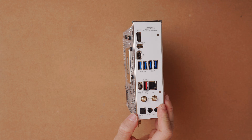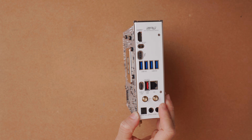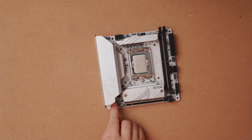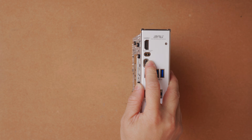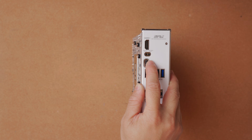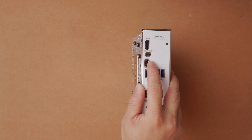Audio on this one uses an older ALC 897 codec paired with an optical output, mic in, and line out. Compared to Asus, which has the slightly better ALC 1220p, this is a step down. There is an onboard audio header in this corner. The MSI has a clear CMOS button, just like the Asus B860-i; however, it also has Flash BIOS capability, which the Asus does not — and that is a very nice feature to have.